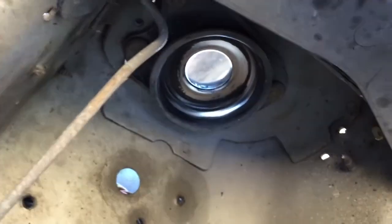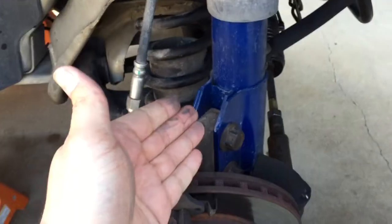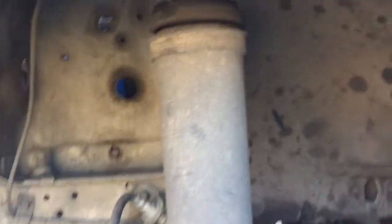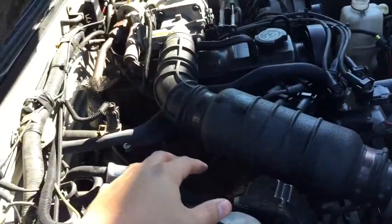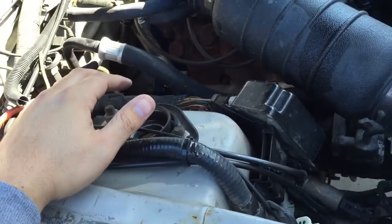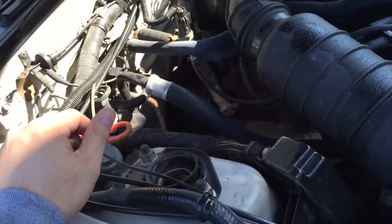You grab the top of the strut, force it down, and that allows you to take all the pieces out — it's just these three nuts on top, then everything comes off. That way you skip the whole step of having to take the strut off. You slide the shims on, put that three-legged plate underneath, put the top plate on top, slide the strut back through the hole, put the nuts on top, and you're done.